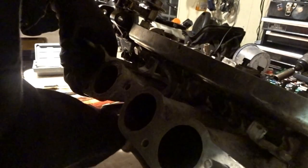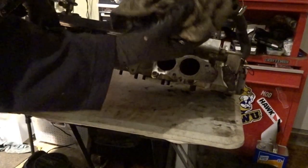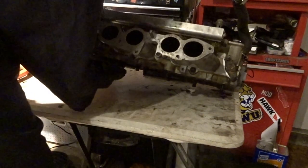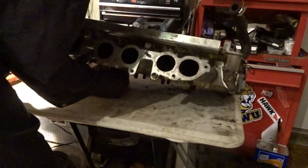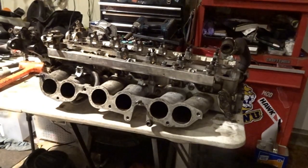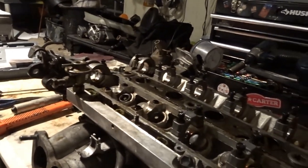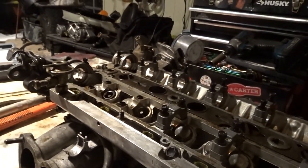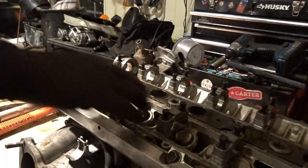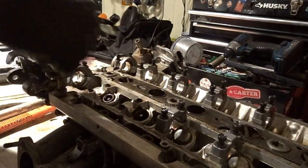After that, you can take the valve and plug it back in. Whenever you try to put the retainer clip back in, it's going to push. So what I do is I get a rag and set it directly under the valve to where the head is like teeter-tottering on it. And then that makes it way easier for whenever I try to put it back in. And let me go back over it. So you see this, then after that, get the valve stem seal.